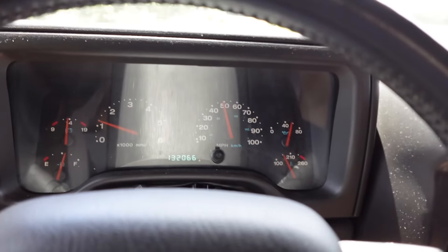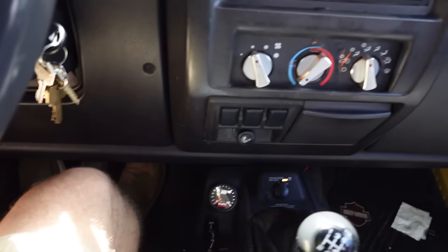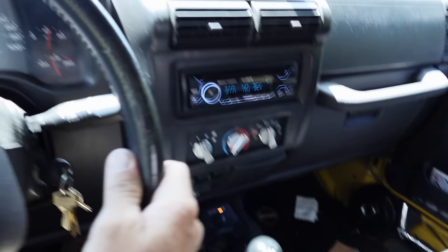That ain't right in third gear. It's almost like a burnt valve to be completely honest. It's like it wants to run good but I think it's pushing air back at an intake valve, fooling all the sensors — the MAP sensor and stuff like that — and confusing it. When I first drove it I thought it was an injector, but now I think it's basically fooling itself.